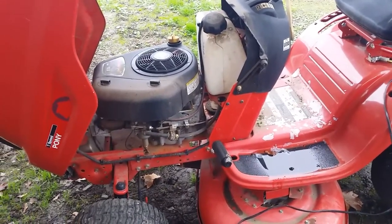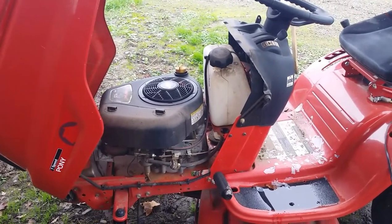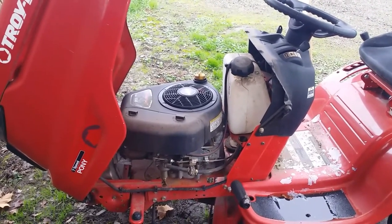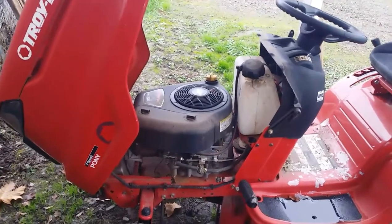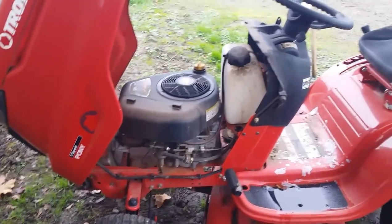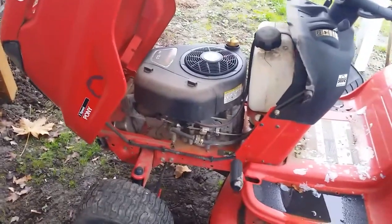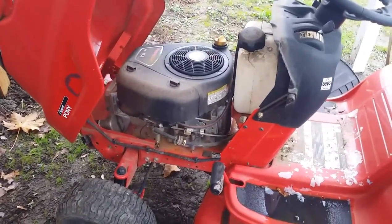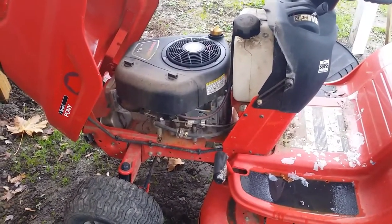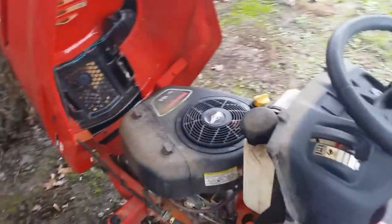There are certainly some commenters who think I should put in a new battery, rebuild the carburetor, do a full tune-up, oil change, filters, all that stuff before ever trying to fire one of these up. I don't really subscribe to that, because if that motor's junk, I just spent $100 that I didn't need to spend. So let's not do that, but we'll just get this thing safe to fire. But again, first thing we've got to do is get that oil out of there. We'll do that. I forgot to on the last video.